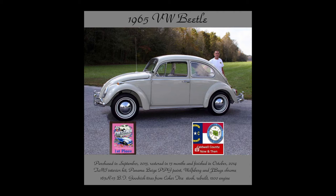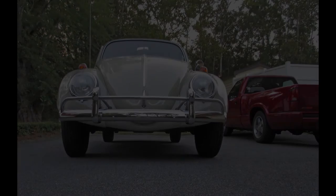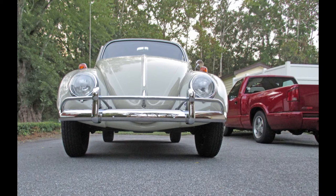If I had not had the same problem with a 1978 Corvette that I bought new - and that is a show car too - it drove the same way, and what that turned out to be was the rear end was out of alignment. What I expected to be true was true: the front end was in line, the rear end was in line, but the two were not in line with each other. I checked my tire wear after running about 300 miles, and the tire wear was perfect, but that darting, driving-on-ice sensation still existed.